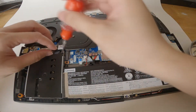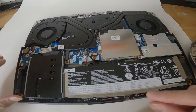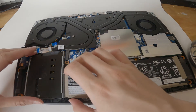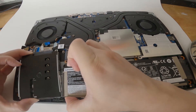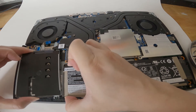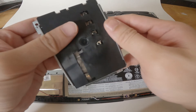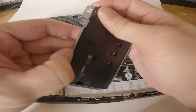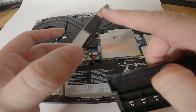Let's take this dummy out. You have to gently lift this battery up because this part here is on top of this holder. So you just have to gently lift this up and you can take it out. Here's the SATA cable — take this dummy out. We just have to lift this side here. You've got four screws here. This is how you hold the drive into the sides here.